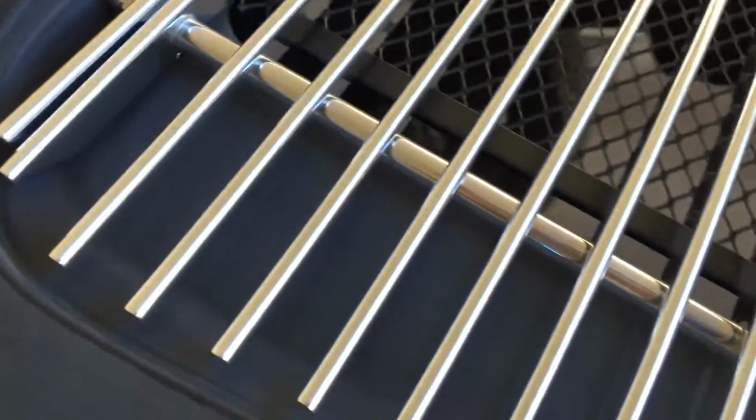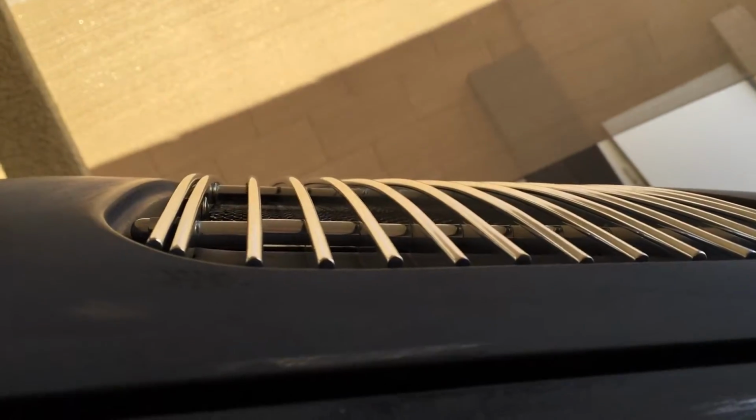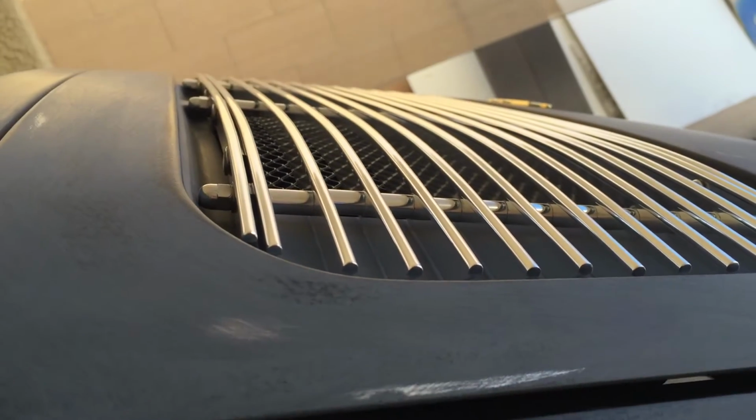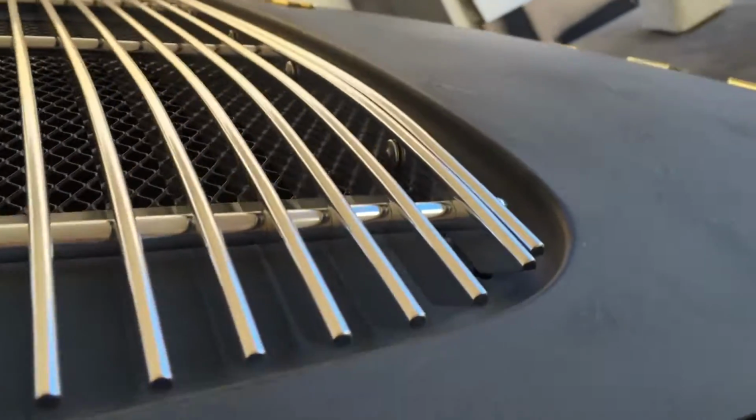But anyway, continuing on here, you can see that nut is touching the paint already. If we come over to the side here, look at the angle. You can see our shape is good. If I have to make clearance to make that work, it's going to be sitting too high on the car, sticking up. In order to clear the paint, you can see this bottom nut here is touching primer also. So this is bad.